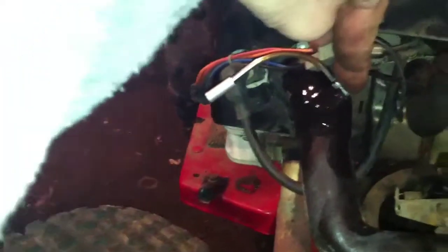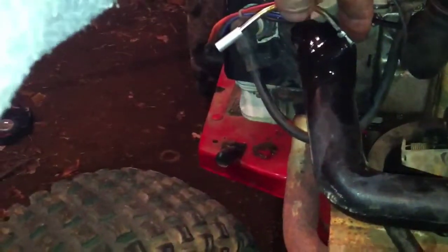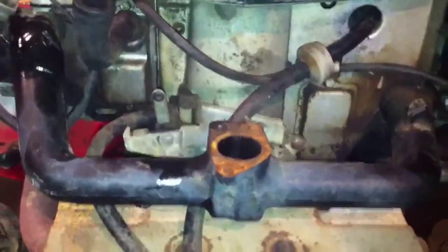We've got the carburetor off and while we've got it off we're going to do a good cleaning on it. I've got an opposed twin carburetor rebuild kit, so we're going to put all new gaskets, new jets, new needles and needle seats and all that good stuff in there. I'm going to use this 90-degree fitting mounted right into the top here so it throws the cable downward toward the pedal - it'll make the cable about two feet long.